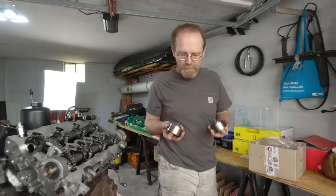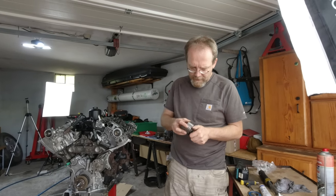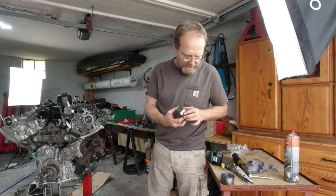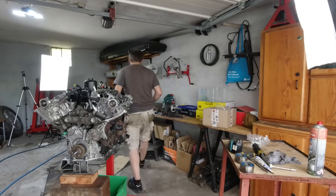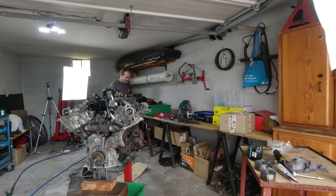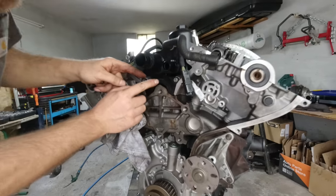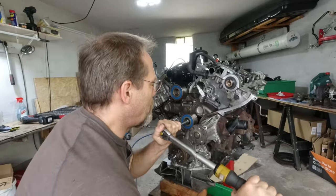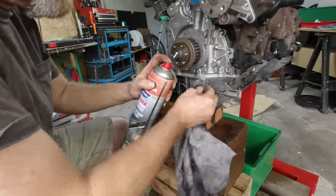Put these now on 42 to 48 Newton meters. This has got to be the best quality bearing ever made. The timing is new on this car — let me just say yes, new pulley wheels. You put this little plastic piece in here so it's in place. If they fall off, you get a new engine.